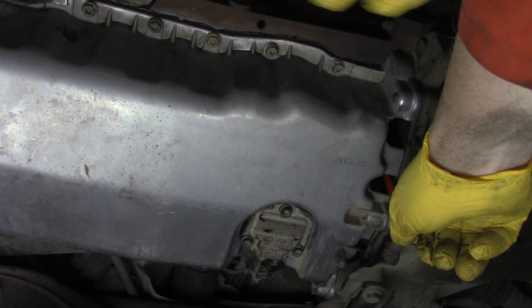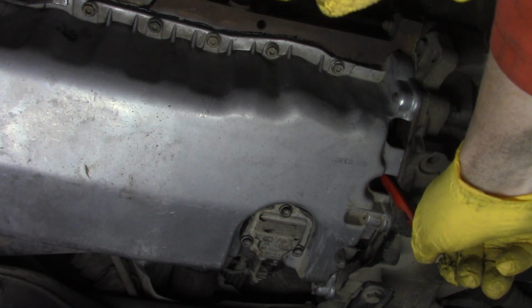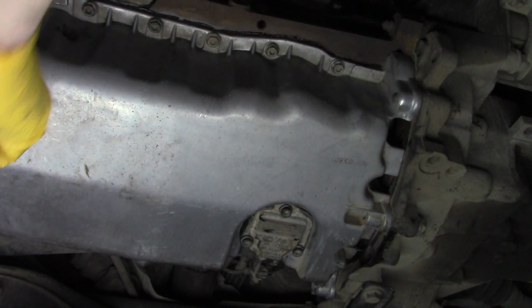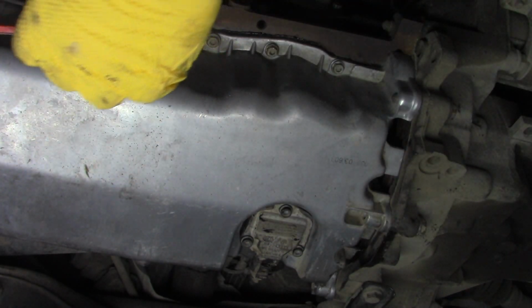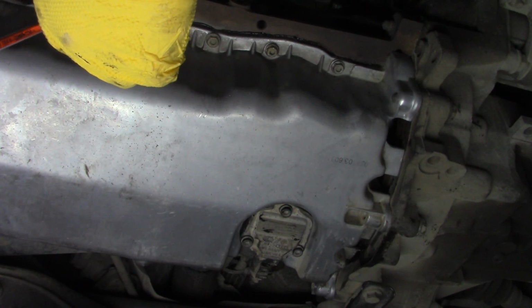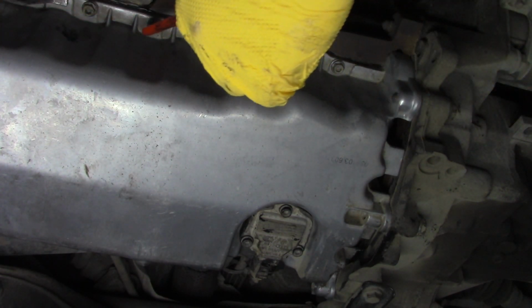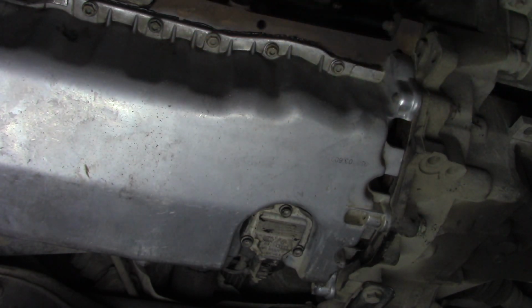You're going to have to take the clutch, gearbox and all out of the car. So just tighten them up a wee bit more than hand tight. Same with the 2 screws on the crankshaft pulley side. They're screwed into an aluminium housing. These ones along each side of the sump screw into the block. But it's not a difficult job. A wee bit of time, a wee bit of patience and common sense, and shouldn't be any problem in replacing one of these.